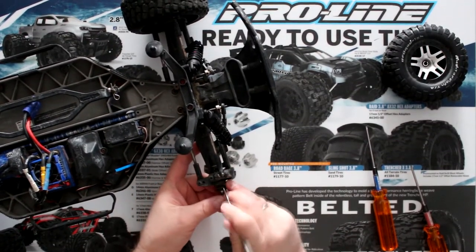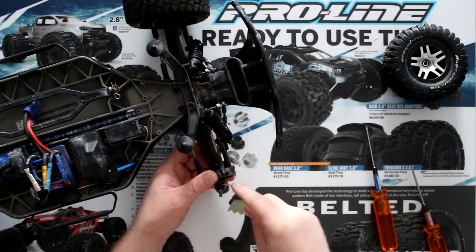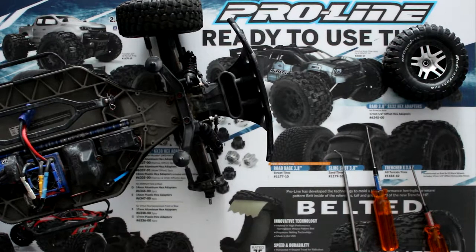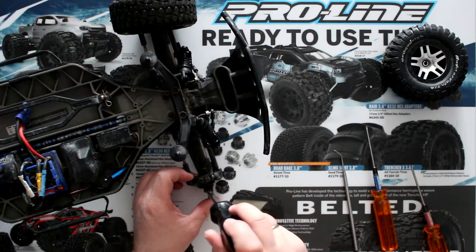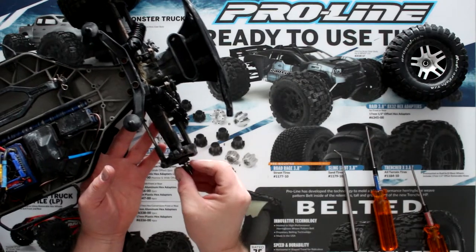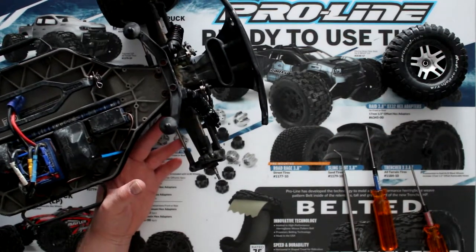To remove the knuckle, one of the first things I do is pop my X-pin out. Sometimes they can be a little stubborn because they sit pretty solid. The pin that holds them — you can grab a flat screwdriver, go in, just twist, and it pops right out. And don't forget to remove your pin.